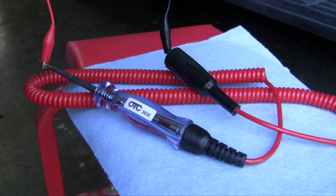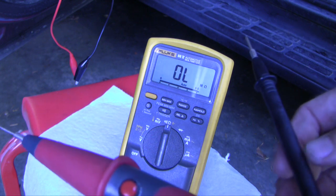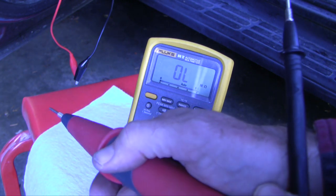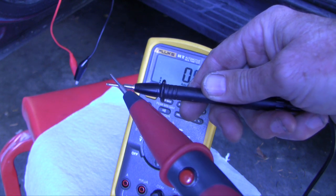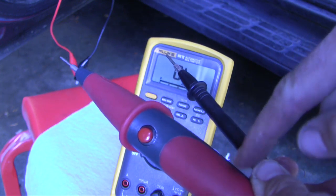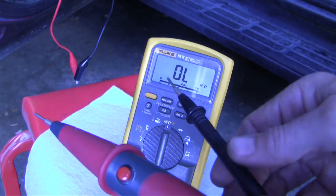Let's do a formal voltage drop test. I'm going to use the LoadPro, which is just a couple of test leads hooked into the multimeter. Whenever you test a LoadPro, always make sure the fuse isn't blown — put it on ohms, press the button, and you should get about 25 ohms. We're getting 25.9 ohms. The reason we get 25 ohms without touching the leads together is there's a second wire that goes up through a resistor and over to the ground lead, which creates a load situation. Now we hook up the two leads and see what voltage drop we get once current is flowing.